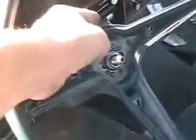And when I get the steering wheel off, then I've got to take the steering locking mechanism off. Then I've got to pull out the signal switch mechanism. And then I take out one more screw and the lock cylinder comes out. And then I can see if it starts.